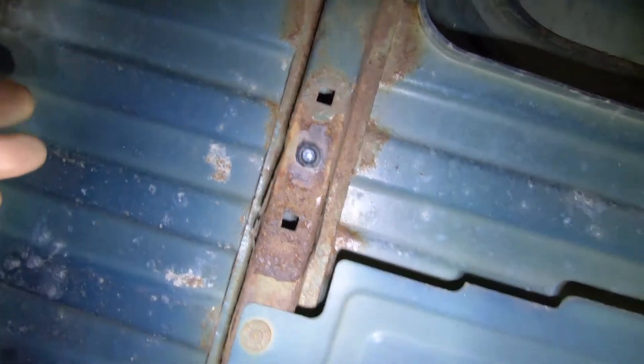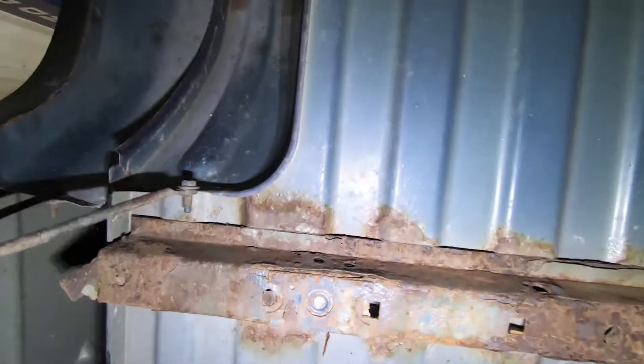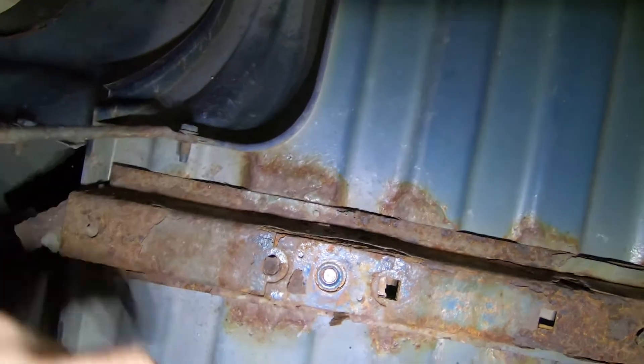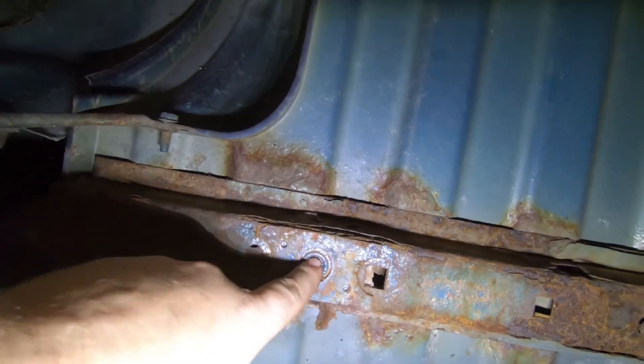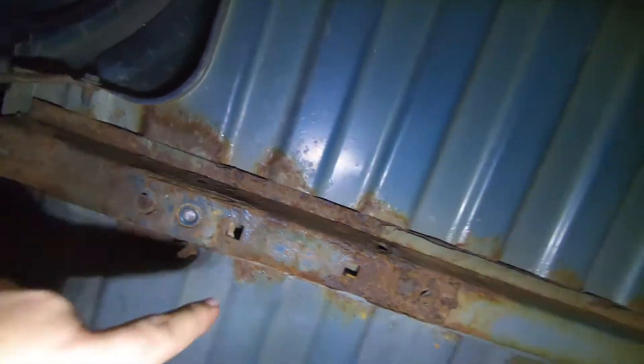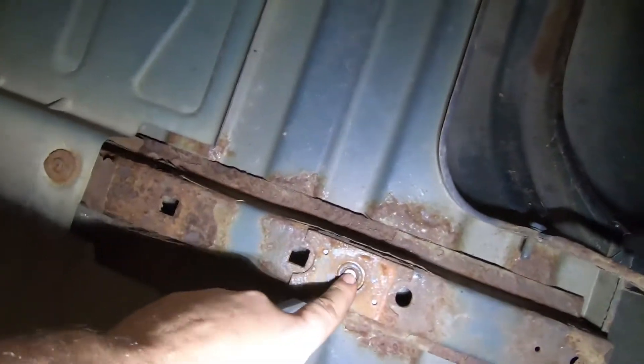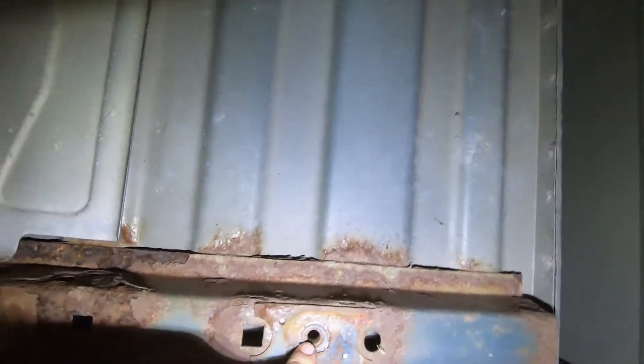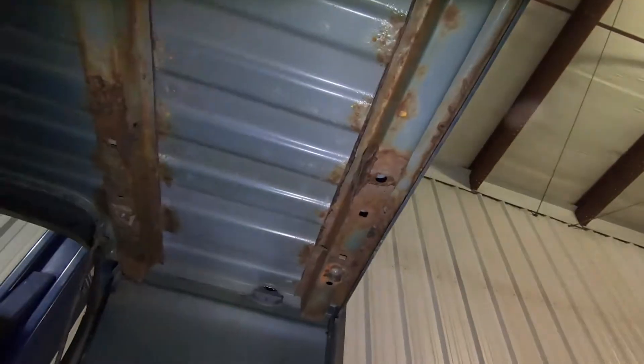And if we did get them out, it's rotted to the point where putting a bolt in there wouldn't do any real good. Now these rails here - although they look gnarly - are a lot better off than the ones back there. We've got a broken bolt here that I know I can weld to; we'll heat it up, crack it loose, and get it out. Same thing with the other side - heat it up, crack it loose, get it out. And then we have a perfectly good one here in the front and another perfectly good one on the other side.